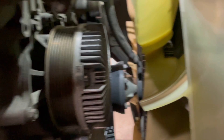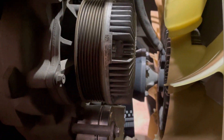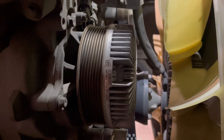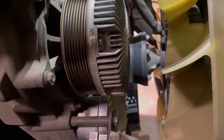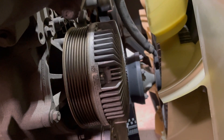The only thing you have to do is disconnect the plug there to be able to get it all the way around. Feed it through the fan that way and then put the belt over the outside, just turn the fan as you're pulling the belt through. I'm going to draw you a diagram of how it goes together just in case you're unsure.